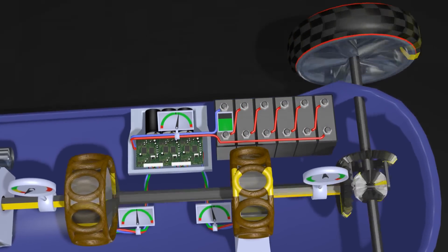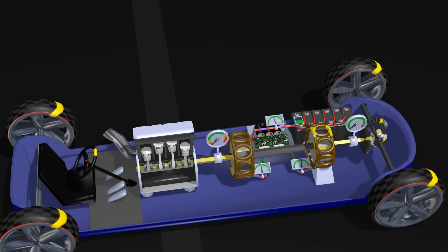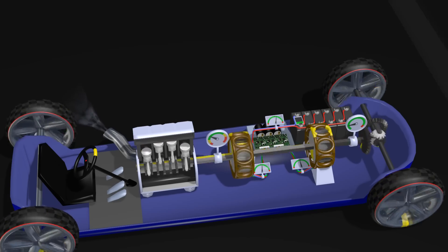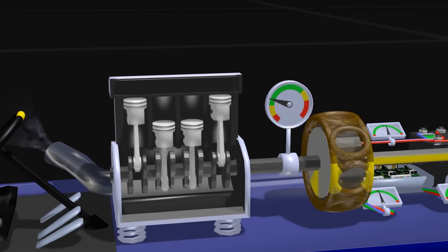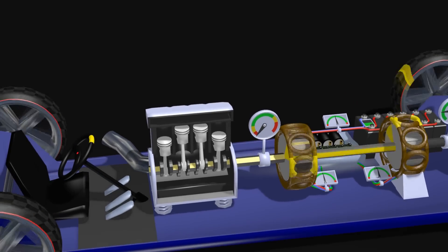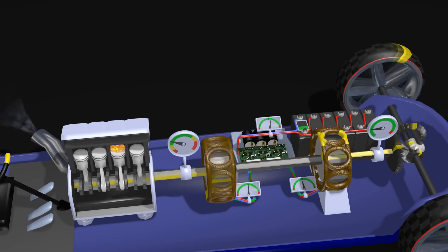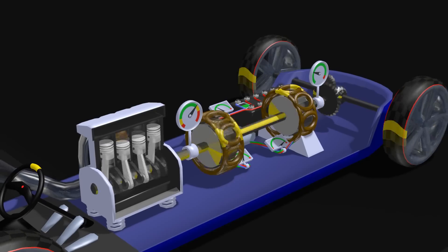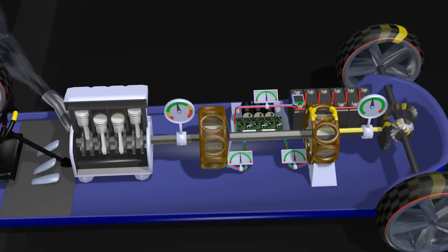Still, with all the electronics in place, why not add one? There are all kinds of tricks you can do with a battery. For starters, at traffic lights you can turn the engine off. You can pull up, get to the next light, without even starting the engine — great in city traffic. When the battery is empty, only then the engine will start. Then the engine will run at a pretty constant speed, which is an efficient speed, filling the battery and driving the car at the same time. And when the battery is full, the engine turns off and you're on battery again. There's a much better use of the engine than in a normal car. A normal car would be either idling or working at a speed that's way too low for efficiency. The engine of our hybrid, on the other hand, is either running at an efficient speed or just not running at all. When you're past the traffic jam, free to make speed, you can get full throttle from the engine combined with the power of the battery in MG2. The Prius has pretty good acceleration actually, for a car with a small engine built for efficiency.